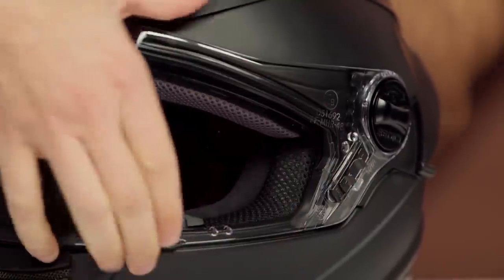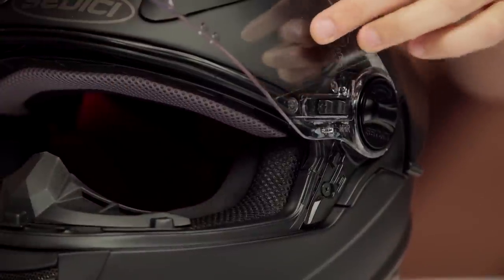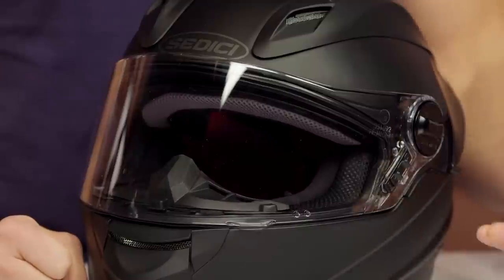The other thing — more of a minor gripe — at the $200 mark there's no shield for this helmet that has a pinlock-ready device. You do have a fog-free coating while riding in this lid, but that will wear off over time. It's chemical, so you'll have to reapply it using a third party. If you had pinlock posts — like even a lot of other entry-level manufacturers have — you can buy a pinlock after the fact, and that creates a double-paned window construction that makes sure you never fog up using the laws of physics, not chemicals. I love that feature and it's missing here. I think an easy rolling change is for Sedici to add a shield that supports that, especially if this helmet is going to continue on for a while.